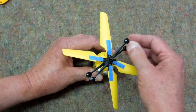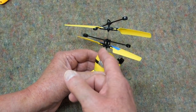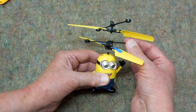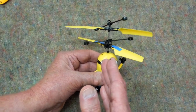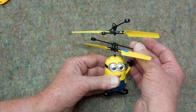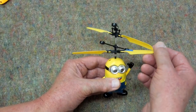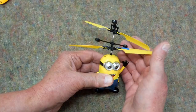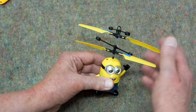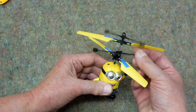The fly bars are not at right angles to the rotor blades. The action of the fly bar precedes that of the blade. If this guy is remaining vertical — rotor shaft vertical — the fly bar acts as a gyroscope and remains horizontal. If he tilts to the side, relative to him that fly bar drops and it increases the angle of attack on the blade on that side, which brings it back to level. That's the action of both of these — it's supposed to stay stationary in the air.